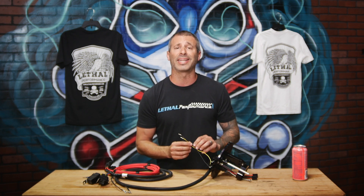You do not cut any other wires, because if you do that will cause issues possibly with your evap system or how the car runs and how it's wired up. We do recommend not cutting any other wires except for the main wires going down to the factory fuel hat a few inches from the hat. Plug in the connector to the aftermarket fuel hat and then connect the two small wires for the level sender to the factory wiring.